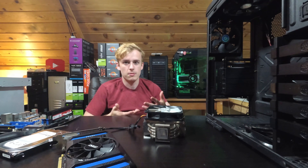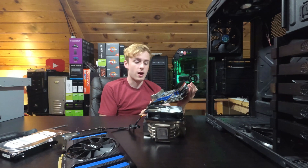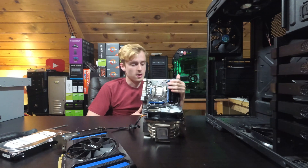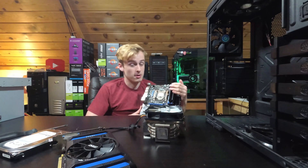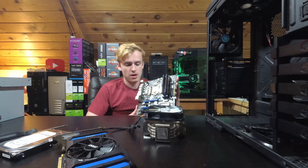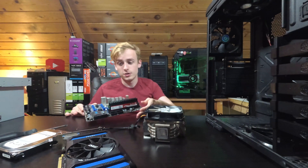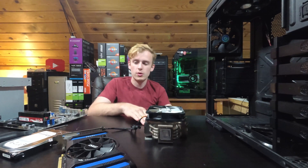So this system right here is what really gets interesting. There's an i5-750 in this socket, and the CPU I have in my test system is a 650, so this is actually a really good deal. The memory is Patriot Sector 5, 1600 megahertz, 16 gigabytes — a pretty good amount of RAM, especially at the time this was probably built. The motherboard was probably about a $50 board at the time, and you can probably get it for around 30 bucks now, but it's still high-end for what we're doing at this budget. For a budget of $30 total, we'll end up with something we can sell for a lot more.